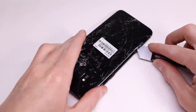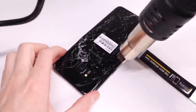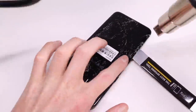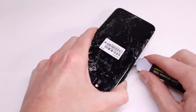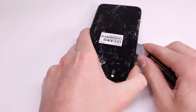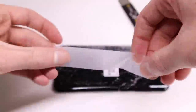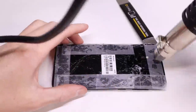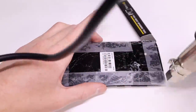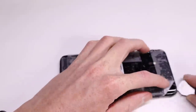You actually have to heat it up and take it off with a metal pry tool because they glue the glass down. It's not like iPhones where the screen comes out first and you just remove the screws. With the Galaxy S8, they're glued on the back, so it's sort of like an iPad repair — although the glass is actually curved towards the outside, which makes it even more difficult to get your pry tool underneath. Because it's curved, if you apply too much pressure it just shatters the glass even more, and this whole step took me around half an hour.